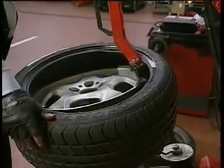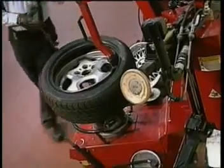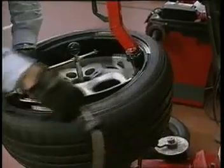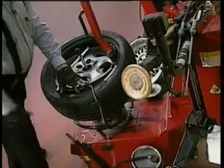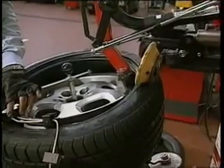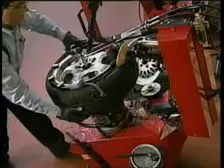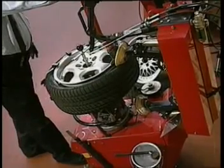Now it's very hard to mount the tire now, so again, I can use this special tool. Very quickly, I just insert it, lock the bead to the rim. Now as I start to mount the tire, I place these blocks in place, and the tires normally jump over top of the mount head. Again, instead of having 3 people with pry bars, I use the roller. All done by one person in one easy step. We can even remove the tool without any force.